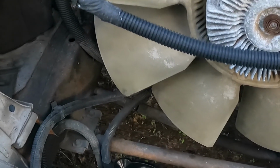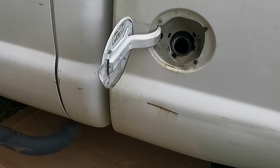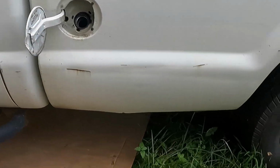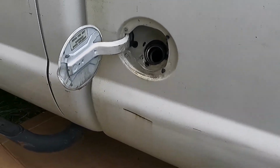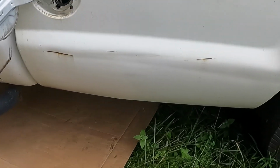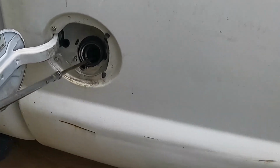All right, one thing leads to another. Well, we did a little test, and I noticed when I was underneath the truck that the pump just sounded like it was free spinning. Now either it's not pulling suction because the line's not primed, or it's not in fuel. So I put 10 gallons of diesel in it and got it up to half a tank.